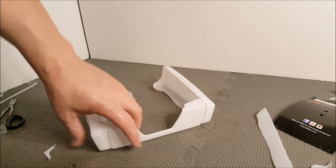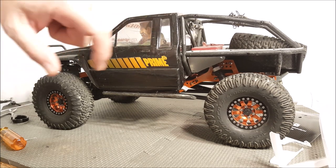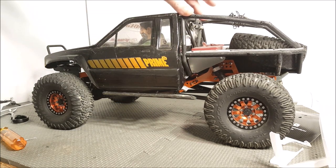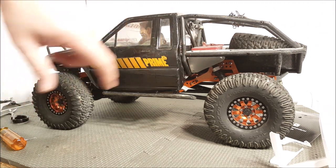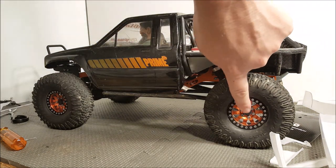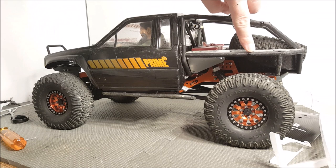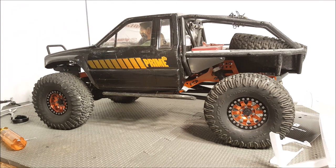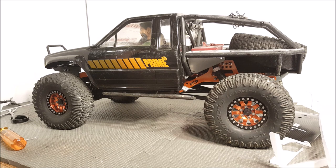I want to show you a little trick first. Ugly Duckling is now on the table. We're going to loosen and take out the screws here and the ones in the very bottom of the Honcho cage, leaving the top ones in place. That way we can just bend this up to slide the bedsides in between the cab and the roll bars if need be. Here's the tip: take your finger, find the center line of your wheel, bring it up, and on the bedside make a little mark. This gives you a mark on the roll bar showing where the center line of the wheel well should be — a handy tip for when it comes time to cut the wheel wells.